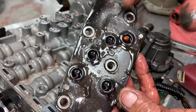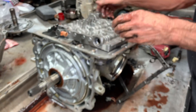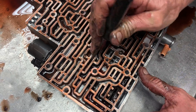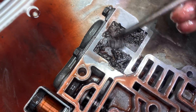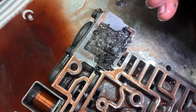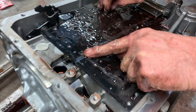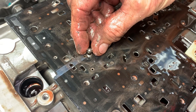This thing is just obliterated. It does have some type of lockup valve situation — it hasn't been blocked or anything, it's all stock stuff. Now it has been rebuilt before — it's got an aftermarket upgrade to the plate right here where the check balls beat through the plate before, and they added this little deal that sets the check ball off the plate.